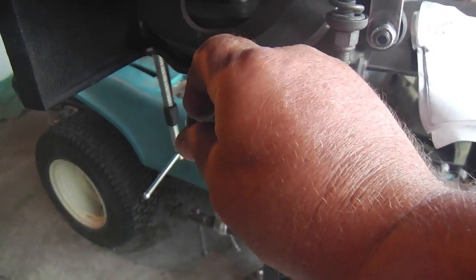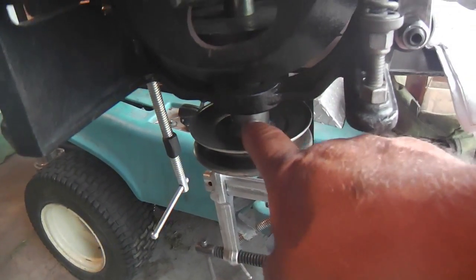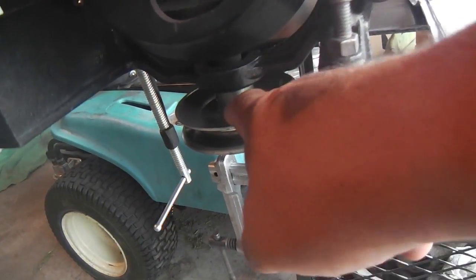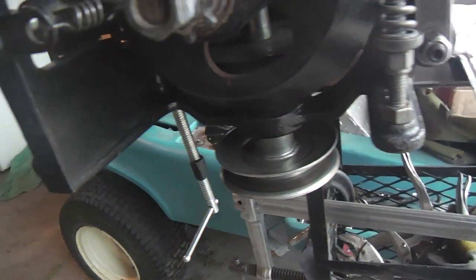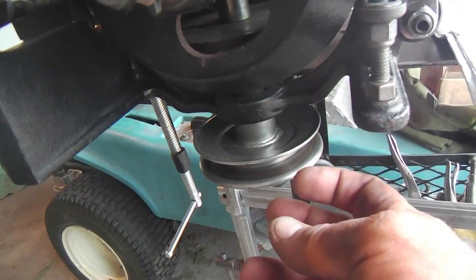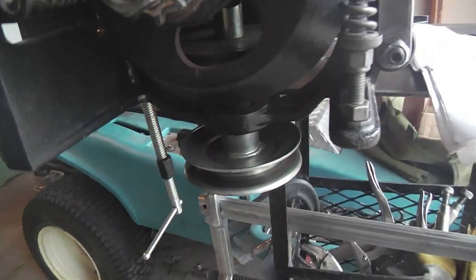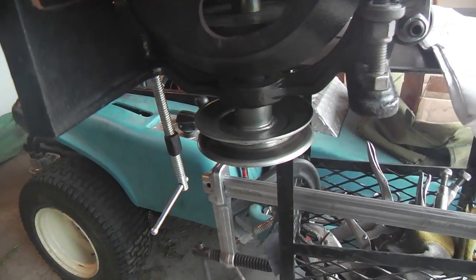So I took the spacer out of there. It set up a few millimeters is all. It wasn't really a washer, it was a spacer, just so it doesn't impinge upon the bearing. But like I said, you can overcome that with a little beveling on these pulleys here. And so when I took that out, I was able to get up on the shaft a little more, put another turn or two on the nut down below, and that held this pulley in place for another couple of months, until it finally just gave out.